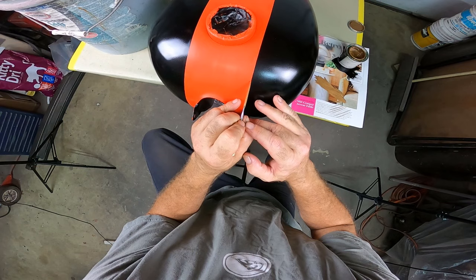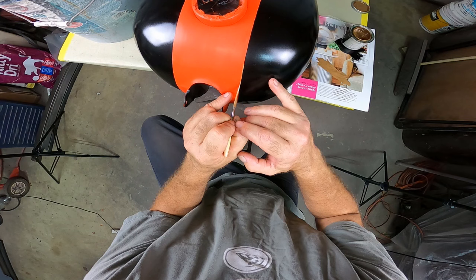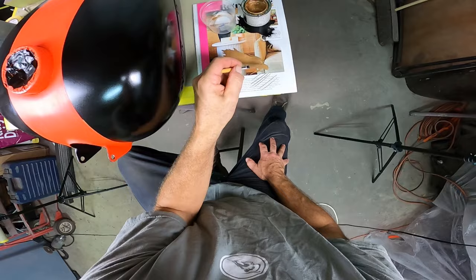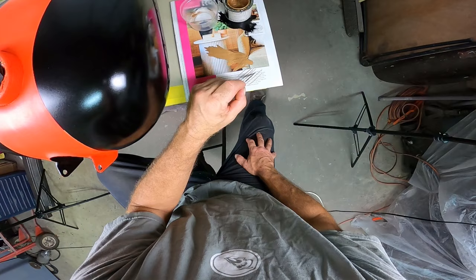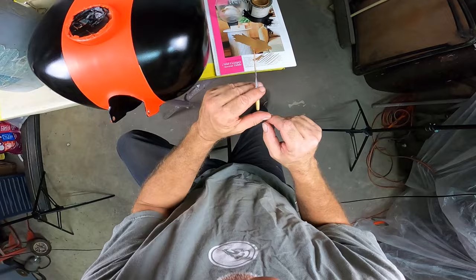All right, and I'm going to try not to bore everybody with this, but there it is, just a thin line. Hand done, of course. I'm staying up on the tip because I want it thin. Come back in, do a little dip. And when you wet the tip, you want to kind of do a test run. See how it's got a lot thicker, so I just want to thicken the paint up just a pinch. This way, it's coming off the tip of that brush nice and thin.